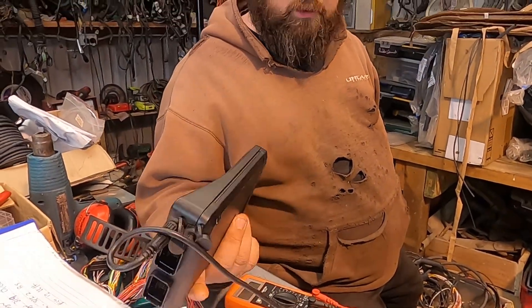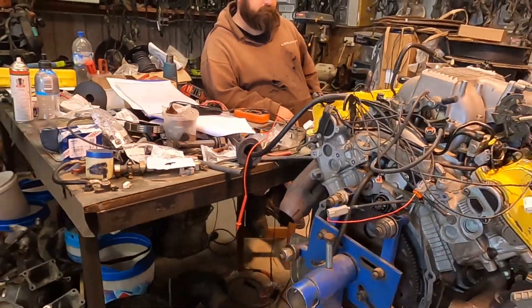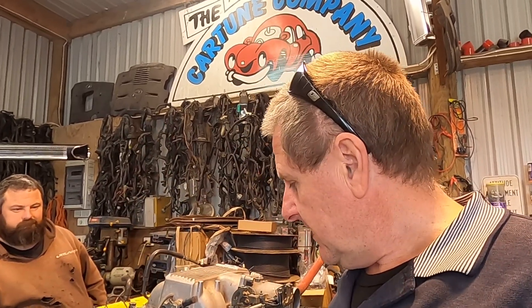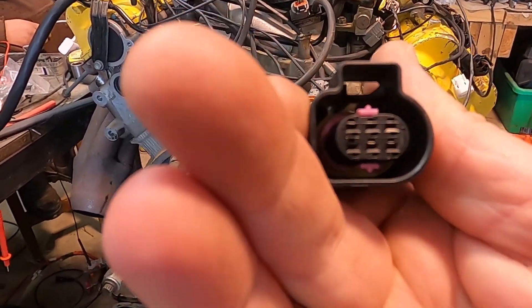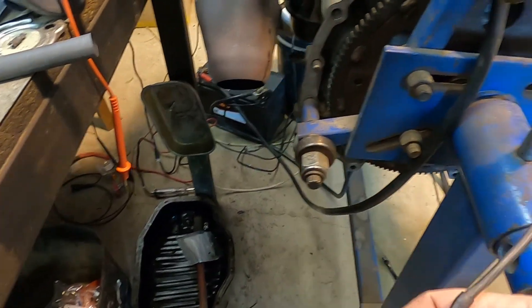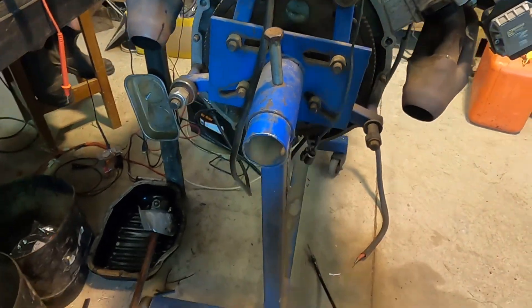I like the Furies — I put them on four cylinders, six cylinders, they work really well. Actually Andrew's Datsun's got one — perfect. The great thing about the Fury is it's got an inbuilt wideband sensor. Jason has done a bit of planning here — he's made it about 500mm so it can get a short sensor down to either bank, or even better it can get a long sensor — about 800mm, which we can supply — and it can go back in the merge.